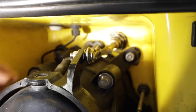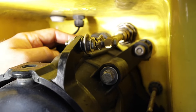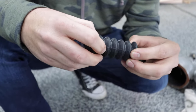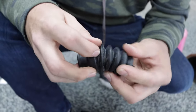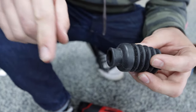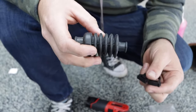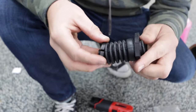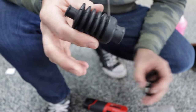Next on our checklist is to check the VTS boot. This one has manual trim so you won't see a VTS boot in there, but here is what a VTS boot looks like — you'll find it in the back of your ski. If you've never done this and your VTS still works, I highly recommend checking it because in between the ridges they get dried out and start cracking on a 96. If water comes through this boot and into your VTS housing, the housing is trashed. A new VTS, if you can find an original, will cost $175 to $225. This is a full kit from OSD Marine — it comes with finger compression clamps and a new boot. Definitely check it, because water getting inside will make your VTS take a shit.